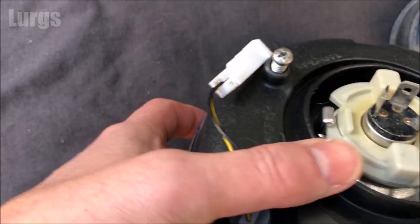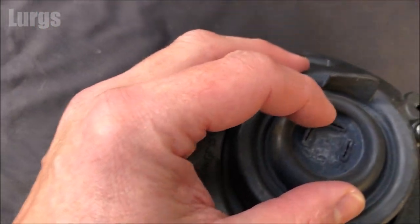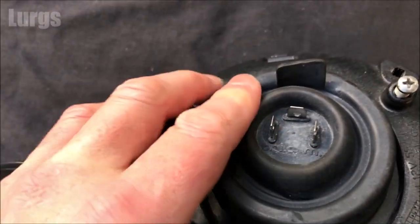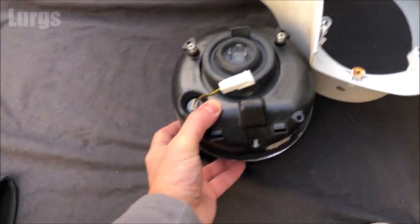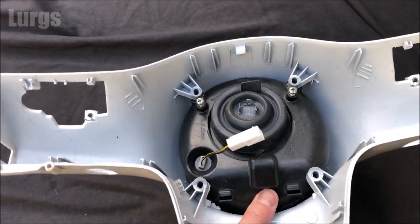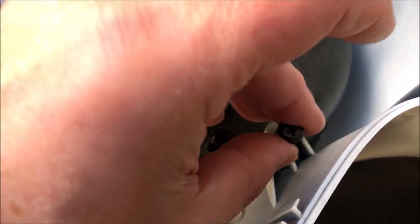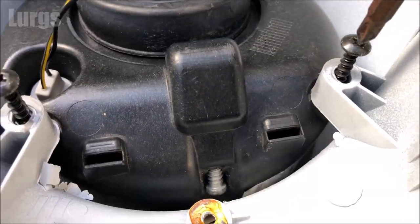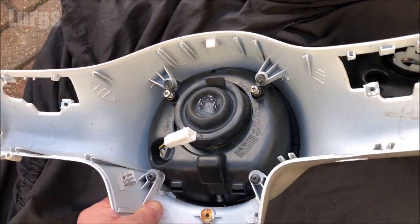Both bulbs are now in the replacement headlamp unit. This one's got a slightly different rubber attachment on it so I'm going to use the one that came with this — just push it down until it fits all the way around. Now this is ready to go back into the headlamp fairing. Just lay it on the top there and those four screws that we removed — we need to put those back in. Always do them with your hands first as these are plastic threads, you don't want to damage the thread. Make sure you get a good bite on it, then just use your Phillips screwdriver and tighten them all up gently. Do all four evenly so it's all nice and uniform — all four screws are now nice and tight.